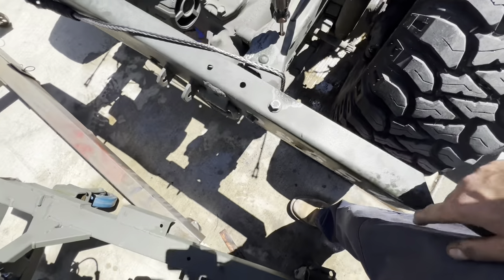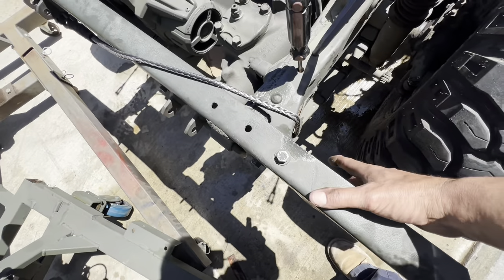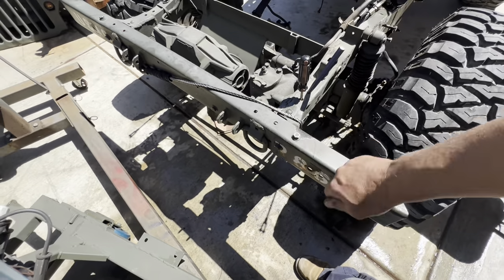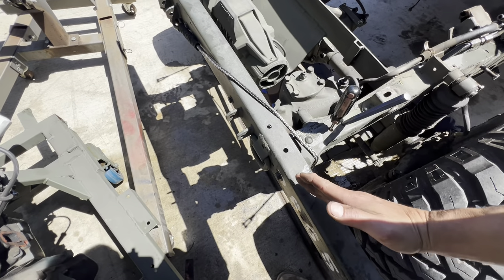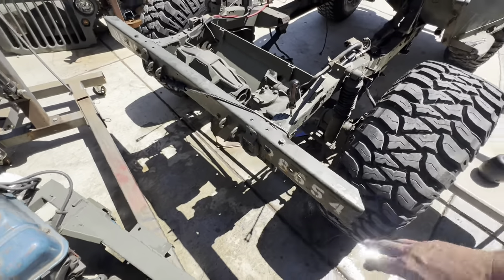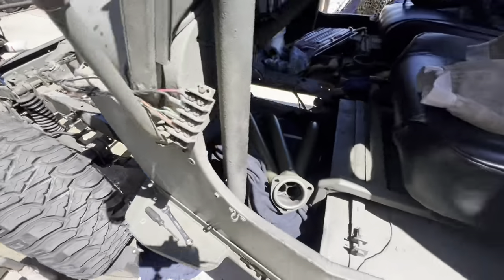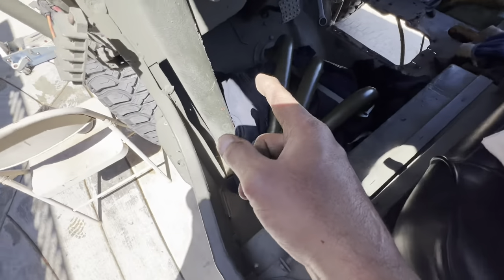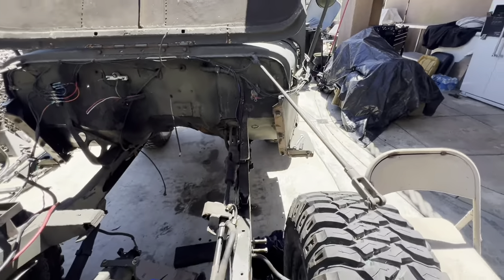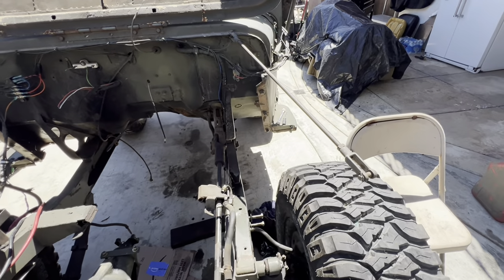You can see where I made my lines to cut. So I'm going to take this off, cut it here, put anything down there and cut that. I usually like to make another line here with the saw, make a gap, hit it with my three pound hammer, get it in there - it makes like a little bow there, and then weld it back on both sides. That way it gives me room and I don't hit the rocks in Moab. The tunnel is going to need some work. Then I need to put a clutch in - playing with the idea of maybe putting a hydraulic clutch on there, maybe building something that's a floor mount, but we'll see how it goes.